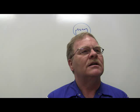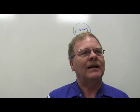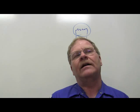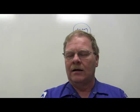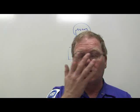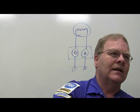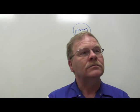Well, you know what was wrong with that car? Somebody put a couple of gallons of diesel in it. Somebody, when they turned it in at the rental place, I don't know how they managed to make it happen because that diesel nozzle's bigger, but they put some diesel in it. And the way we found it was, I got a sample from the fuel Schrader port on my hand, and I waved it around. After I waved it around and the gas had already dried off, I smelled diesel. The diesel doesn't evaporate like the gas does. So I unhooked the fuel line from it. I got my injector cleaning machine and hooked it up, and I dialed the pressure to where it was supposed to be with good, fresh, clean gas, and it ran like brand new.